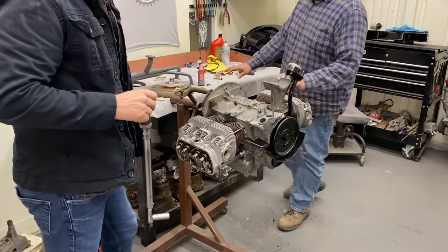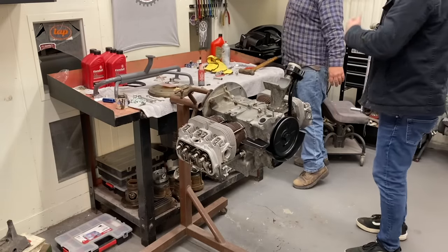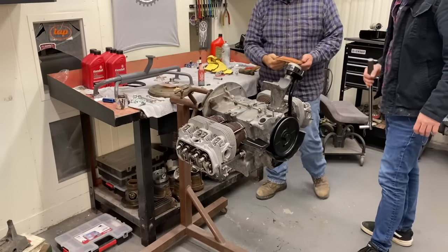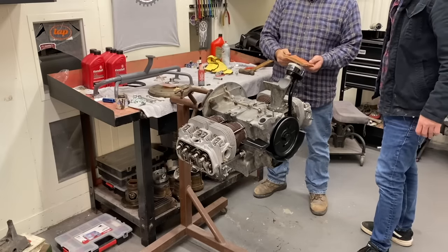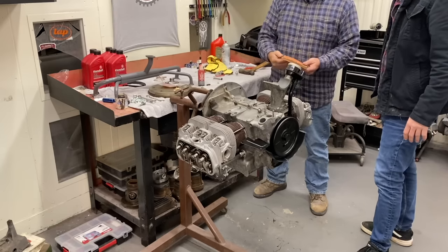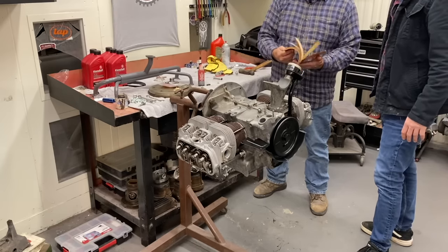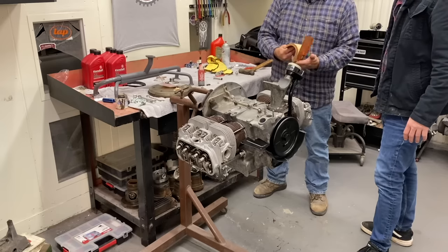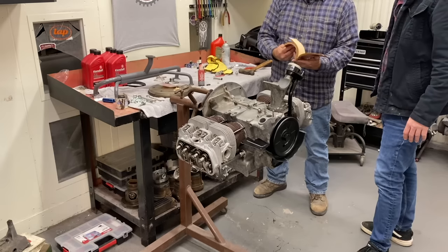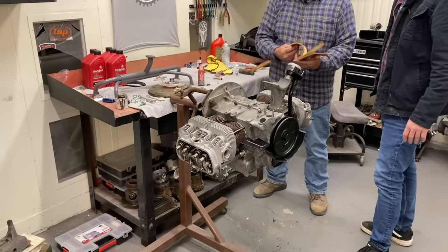That's the factory setting. You can refer to this book. This is the book I like to use. Everybody asks me what books I use, and I like the Without Guesswork manuals from Volkswagen. It's probably similar to the service manual you have. You can go online and look at these, and you type in your year car, and these have all the specs for your car, from the crankshaft measurements to ring and pinion backlash. Any kind of measurement that's in the car is in this book. Torque specs, anything.